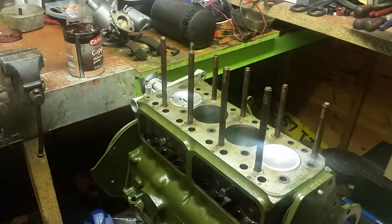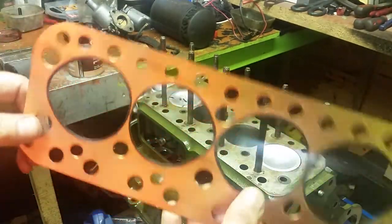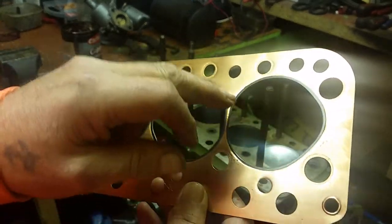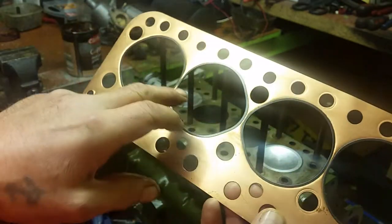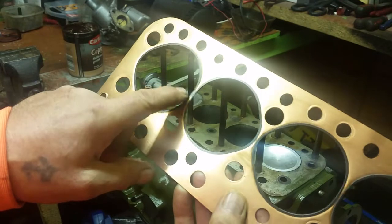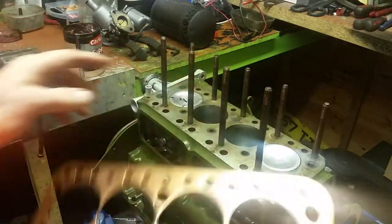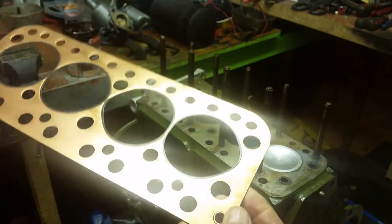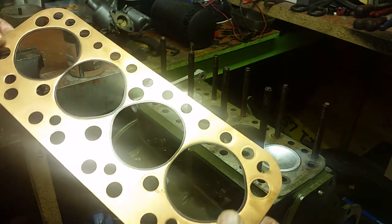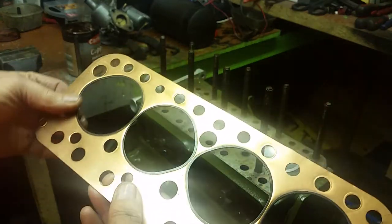You get what you pay for with head gaskets, in my opinion. This one is from the Morris Minor supplier and it costs a little bit more, but it's a better made gasket - it's more of a composite material that looks more substantial than a cheaper gasket. That's where your gasket will fail - it's very close together, probably less than a quarter of an inch. There's a crush part on it and I always put these gaskets copper side up. If you've bought a top quality gasket, copper side up is the general consensus - if you look on social media channels it'll tell you copper side up.